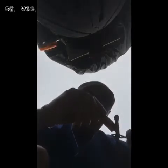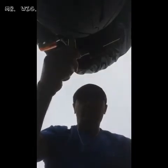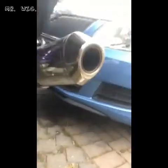So open a little hole actually with this tool in the middle. There you go. It's done. And put some glue all over the piece of rubber. Just put more, spread it well. Put some on the tire, and let's go into the hole. Look at that.